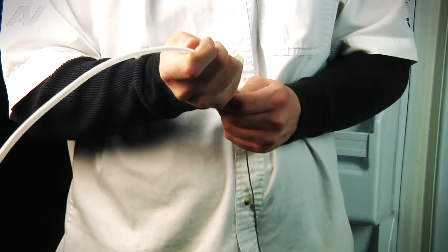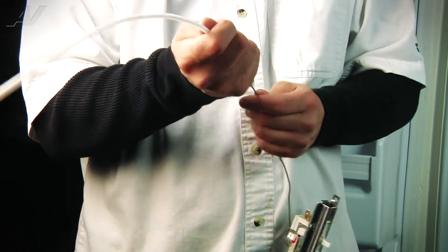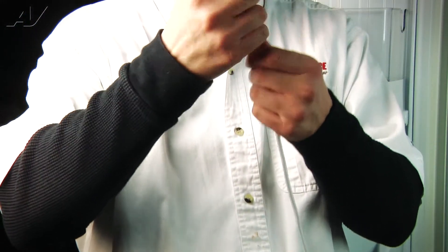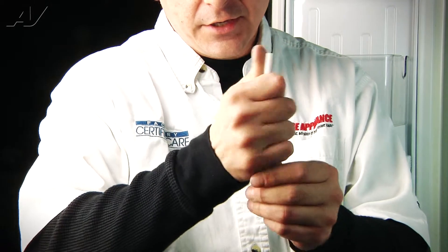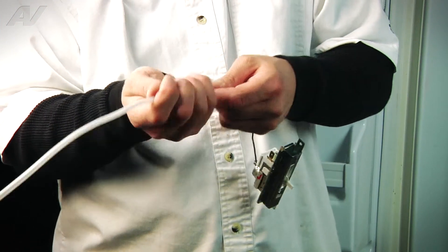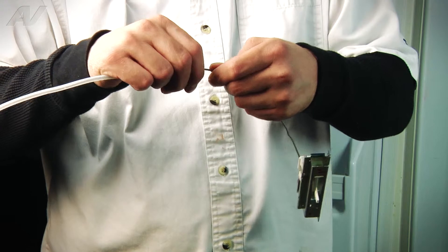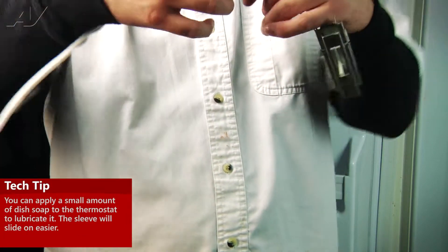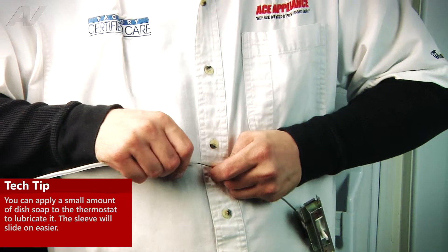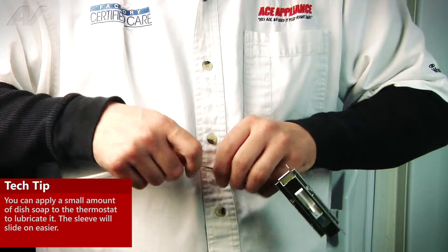As you're pushing it through, since you are using the old plastic sheath, you may get a tough resistant spot. When you do, you may have to find where it's at as far as the bend goes and straighten it back out. Warm it up a little bit with your hands to try and get it to stay straight and get a little more pliability out of it. Once you've got that done, bring it back up and push it back on. Keep your hands really close to the part where you're pushing because you don't want to be far away and push and kink and bend this line.